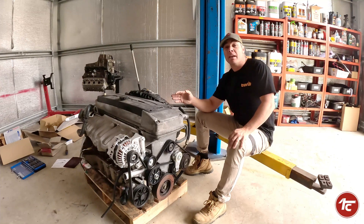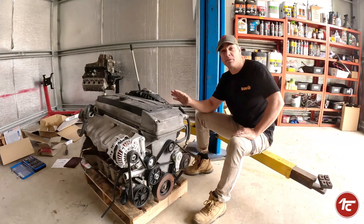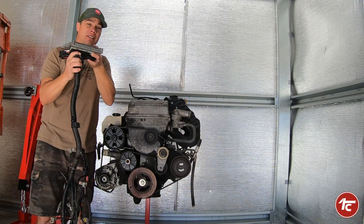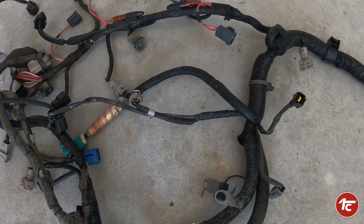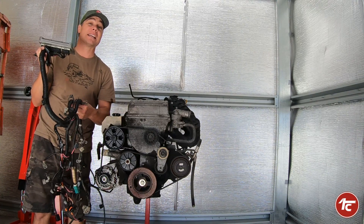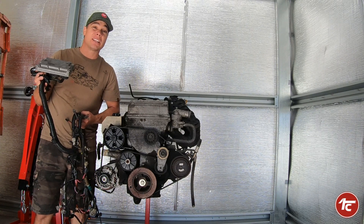No matter what engine you're putting into your vehicle, you need to do some basic prepping. We're not doing any rebuilds or stripping the engine down — just the basic things we need to do. First, we need to remove the wiring loom so we can send it off to Sideshow. There's our spaghetti wiring loom. We're going to send it off to a professional who will make it into a standalone wiring loom so all we need to do is plug it back in, hook up to the ignition, and hopefully turn the key.